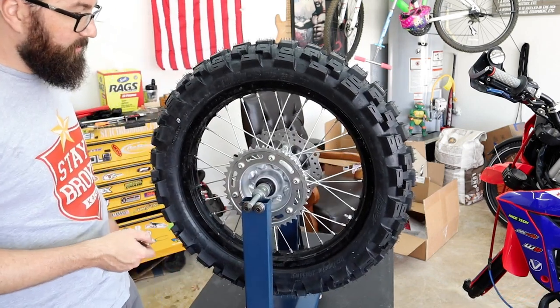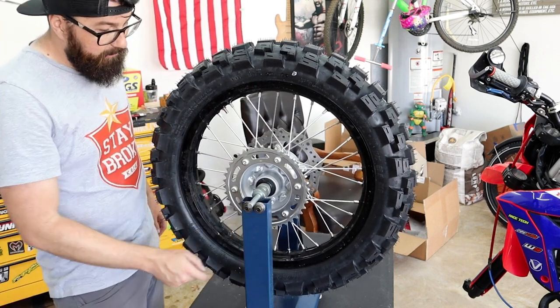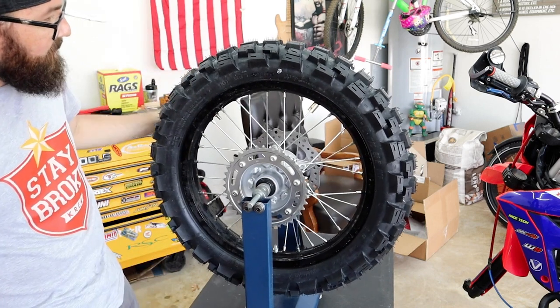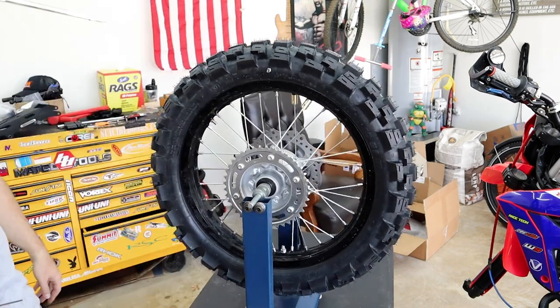We let the wheel go on something like a truing stand, and as you can see, it's gonna rock down and the heaviest point's gonna be at the bottom. So we need to add the weight directly above it. So let's start with one of the big boys. It's gonna at least need one of these. All right, so we put one of those on there. Let's see if that makes a difference. Nope, this is still the heavy spot. Still falling that way.